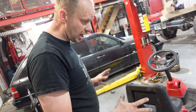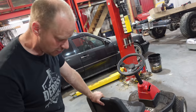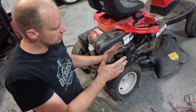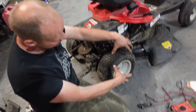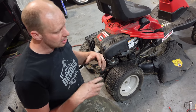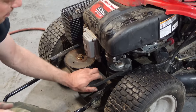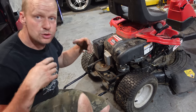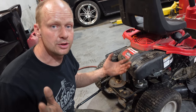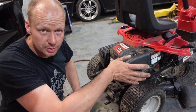All right, we're going to start there. There's not much else to do. If you've got some WD-40, spray anything that moves — steering, anything that squeaks. For flat tires, just put the sealant gunk in there: deflate the tire, put the gunk in, inflate it — the gunk fills all the little spots that are leaking and your tires are good to go. Take your blades off and sharpen them. Make sure your belts are in good shape; have one on hand and keep the belt number written down. Then pressure wash it, maintain it, change your oil and spark plug, and you've got a nice running machine. If it won't start in the spring, do basically what I did and run premium fuel because there's no ethanol in it.